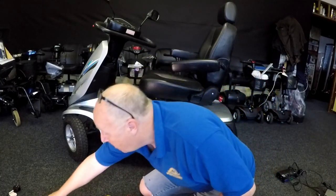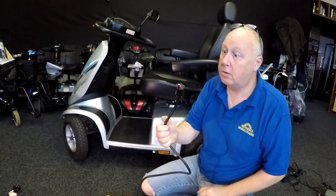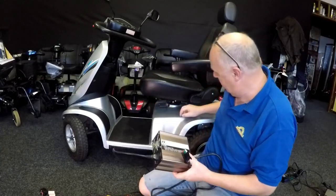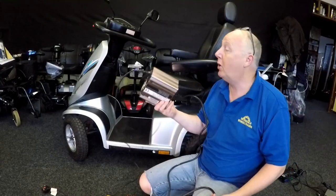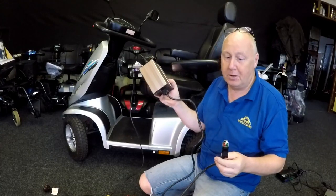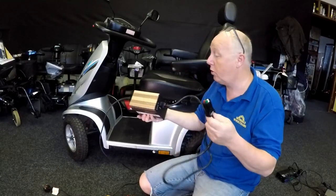The annoying thing with this one is I can't test it with my tester meter. The reason is this is a 15-amp charger — and there's no need for this scooter to have a 15-amp charger. The batteries on this are 12-volt, 75 amp-hour batteries. An 8-amp charger will do exactly the same job. 15 amps will charge quicker, but if you had to replace this charger it's well over £140 because it's a 15-amp with a specific connector. This is a Strider scooter, it's 10 years old, so I don't think this one will still be available — you'll have to do some modifications.